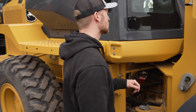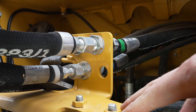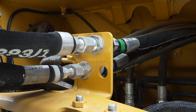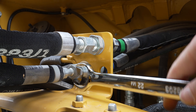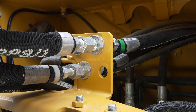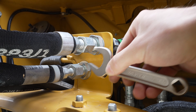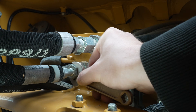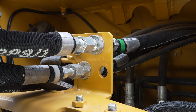Let's take a look at a situation with hydraulic hoses on this wheel loader. We're limited by the plate below and these two hoses above the fitting I'm going after. We'll try the combo wrench first — it's not able to actually get a hold on that fitting. So let's try the service wrench next. The service wrench is short enough to come in here and get a hold on that fitting, so this would work. We'll try the crowfoot next.